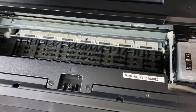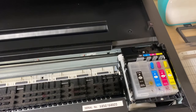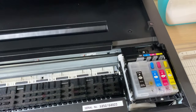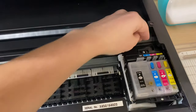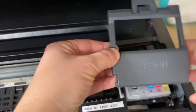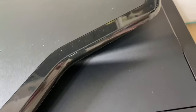I think this foam area is meant to get ink on it, so don't freak out if a puddle splashes or goes through — it didn't ruin my printer. Once you're done with your syringes and you've pushed all the ink through, this process took me about 10 minutes to flush all the ink through. It doesn't take that long but it is tedious. When I pushed the syringe for the magenta, I heard air bubbles, so I kept pushing until I didn't hear the bubbling sound anymore. The cyan worked really well with just a little air — I pushed a little bit and it worked fantastically.